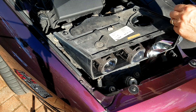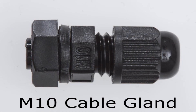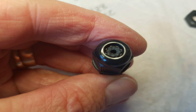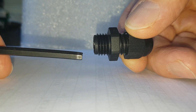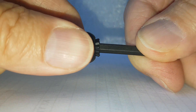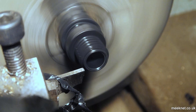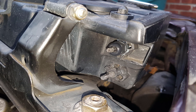My one has completely disintegrated. I can take the cover off there, reach the rods, and pull the rest of the bobbin off. We're going to replace it with a cable gland — these are really useful because we can fit them from the outside, and when the nut at the back is tightened it compresses onto whatever goes through the centre and holds it firmly. I've turned off a bit of the captive nut so it goes into the housing further, but you don't need to do that. Apply araldite to the threaded parts on the left only, push it into the headlamp assembly using five-minute araldite — which takes about an hour to fully cure — put the nut on loosely, and leave it.